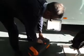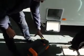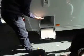You can put a shot of blue in there to make it smell nice and break down the waste. Don't put any water with it though, okay? And you must drain off the flush tank for the winter. Just take the little bulb out.